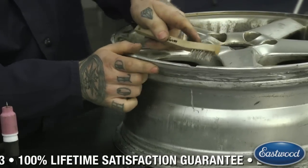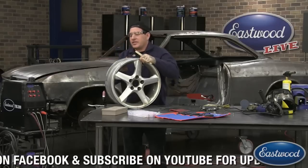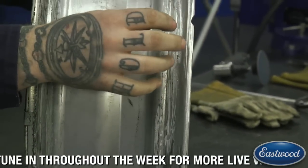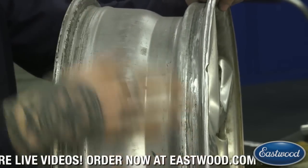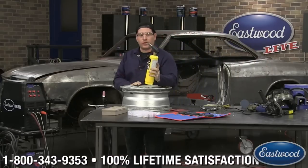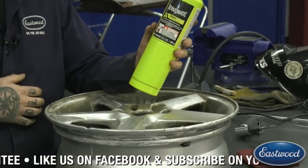Because this is a big aluminum part, we are going to have to preheat it. I'm not going to go as crazy with the brush as I would if this was something smaller that we didn't need to preheat. Now, the other thing — I hit the back side of this wheel. You need to make sure that you clean both sides of the material because if we left the paint or powder coating on the back of this, it may burn off and actually burn and pull into our weld, causing additional contaminants. So I've hit that with the grinder as well, gotten all the material off. We're also going to heat that area with the torch. What I have here to make things simple today is a little map gas torch. You can use an oxyacetylene torch or a propane torch, but propane takes quite a bit longer to heat the material. So I'm going to use map gas — it's pretty quick and it should help heat the metal up.